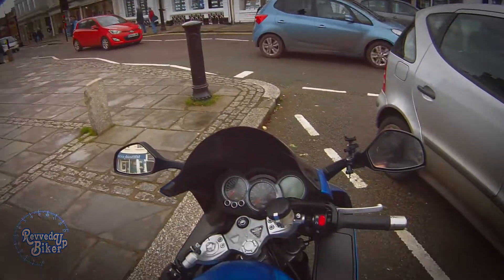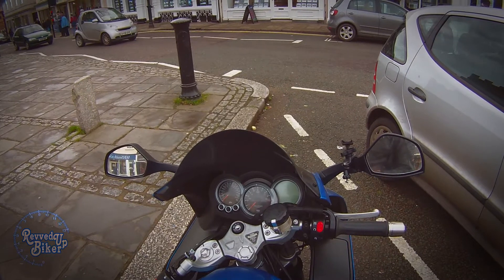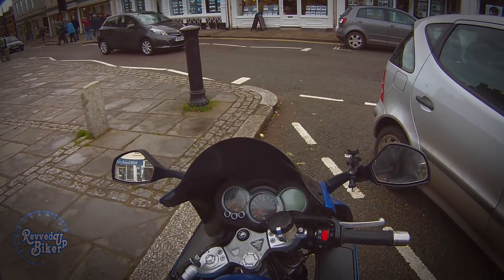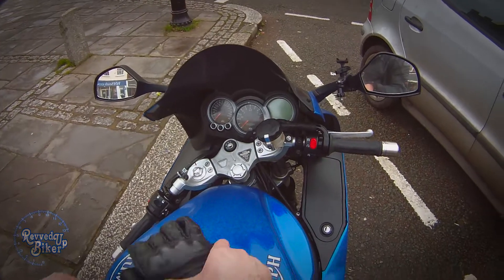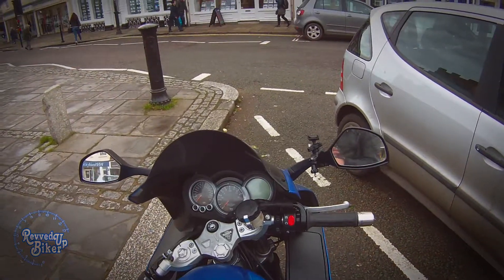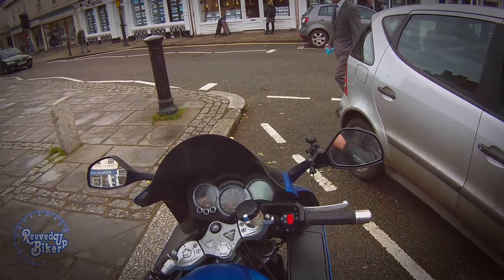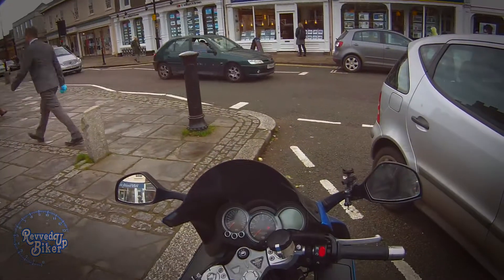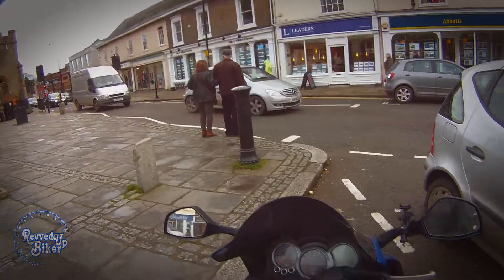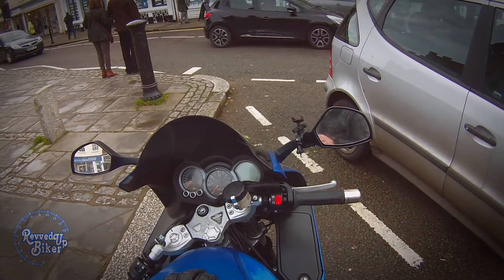Last year I was doing a ride to Cambridge for the American cemetery and Bex88 was on the ride as well. She actually went past me and saw me in a lay-by - I'd pulled over and broken down because the battery had conked out, died out of power, the whole bike just went dead. And that was with a brand new stator and brand new regulator rectifier, but still it's doing this problem of not sending the charge to the battery properly and having this intermittent problem. So I'm going to need to get something that's got a lot more beef in it, that's not so cheap and cheerful.